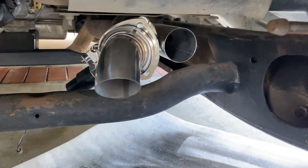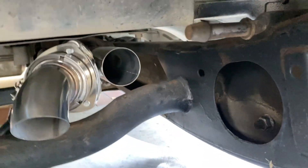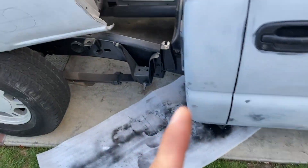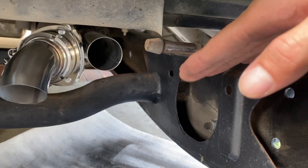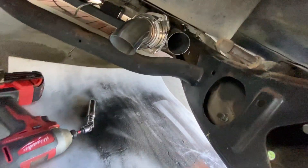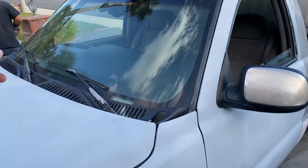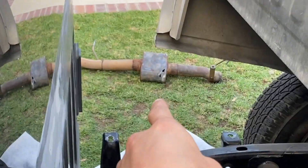That's basically how we have that set up. From this tip the next muffler is going to go on. The only thing in the way is this mount bracket for the muffler, so we'll have to cut that and weld it somewhere else. Other than that the muffler should fit pretty flush right here. Then we'll get those hangers off so everything clears, get that one tacked on, and move on to the next muffler.